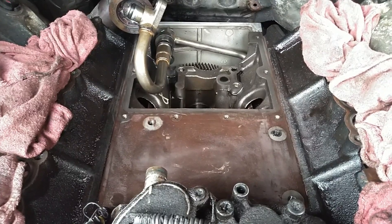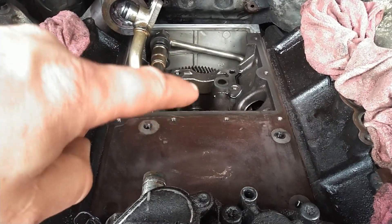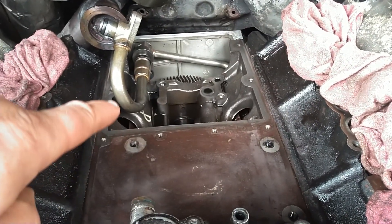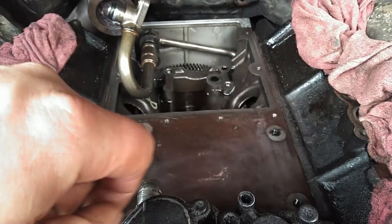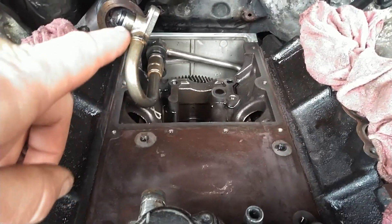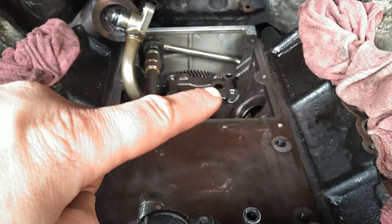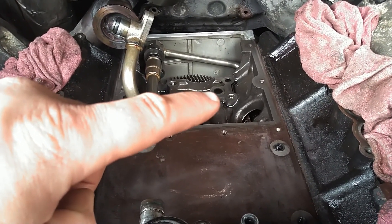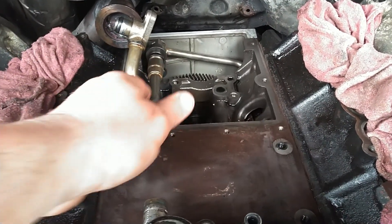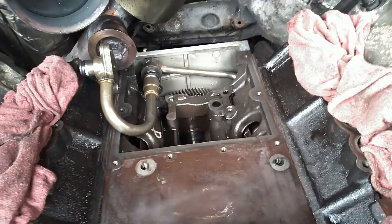I already got the valley in here cleaned up. I used my carbide scrapers and cleaned all of that - anything that could get contaminated - and I was real careful not letting anything fall down in. Then I take a blow gun and blow out the holes for the cover mount and the turbo pedestal mount. Everything's blown out and clean. That o-ring's in the kit so we'll replace that. He did not want to replace the branch tube so we're just gonna get that o-ring out right there.